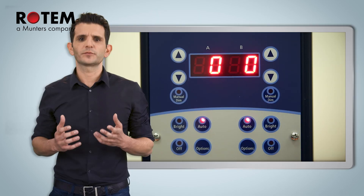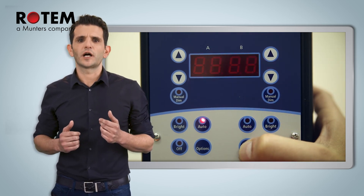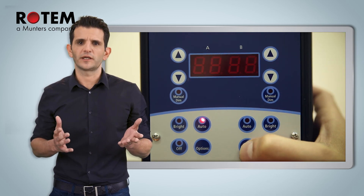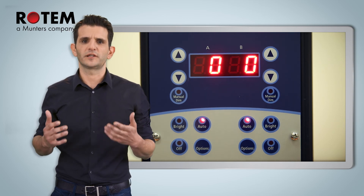At this point you are good to go, just a couple more features left. Now let's choose the pulse level. Some bulbs react better when getting a strong electrical pulse for a split second when they turn on. This parameter will determine the pulse strength. Press and hold the options button for three seconds and go to PU. Now choose the level: 0 means that this function is disabled and you will have no pulse, and 1 to 9 are the lowest and highest pulse levels.